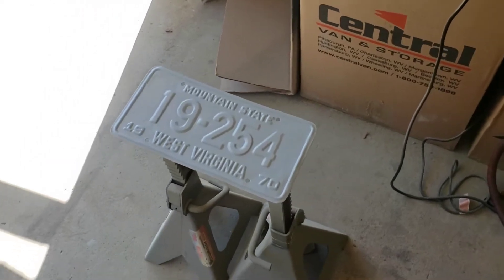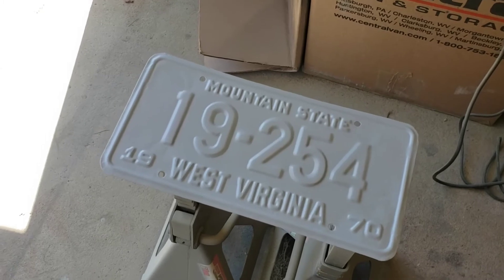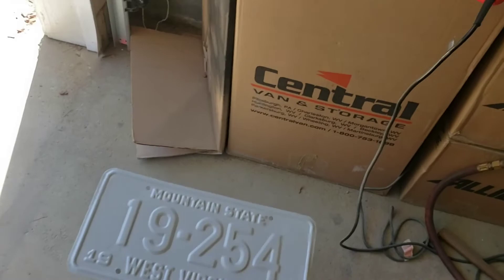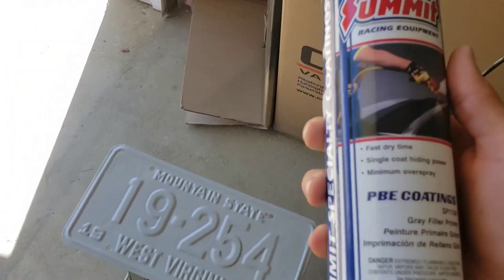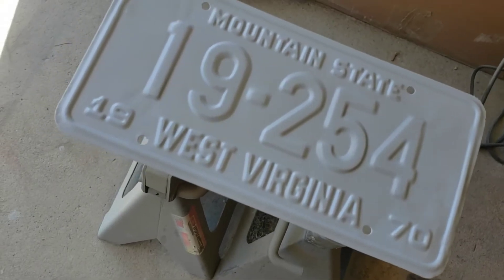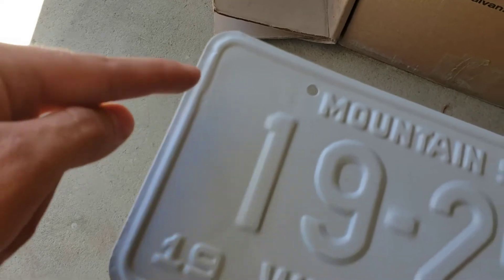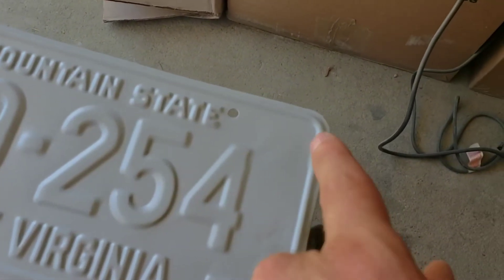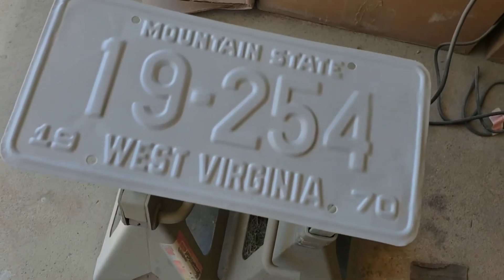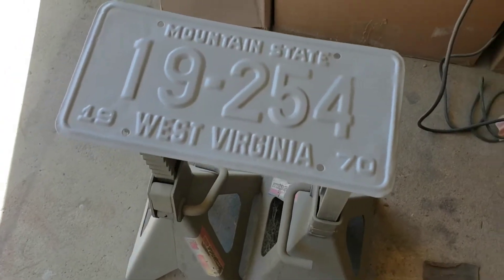The epoxy primer is done. I let it dry overnight and now it's a new day. Today I've already started to spray on some filler primer. I sprayed some down earlier and I've already kind of sanded the areas that are a bit low — there's one right there I'm worried about, one right there, and one right there. I'm just going to keep layering it on until I can get this somewhat flat.